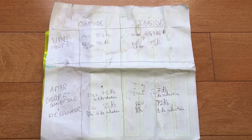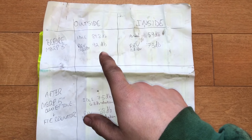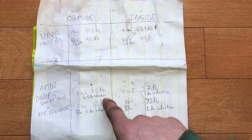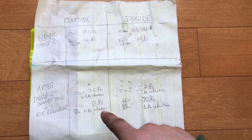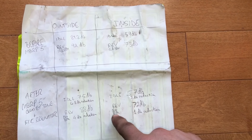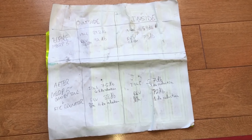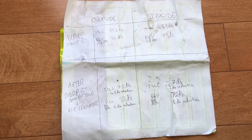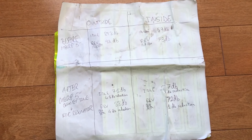Here are the results after the installation of the muffler and the resonator — outside and inside, before and after, with the reductions. On the outside before, it had an idle at 81.8 decibels, and after, a reduction of almost 7 decibels down to about 75. The outside had a higher reduction than on the inside, because the inside reduction was only 1 to 2 decibels. But overall, it does seem quieter than the muffler that was on there before. We'll see how it is on the highway for drone and overall sound reduction. Thanks for watching — hope this helps if you're looking into getting an MBRP QuietTone muffler or looking to see if you want to get a reduction in drone.